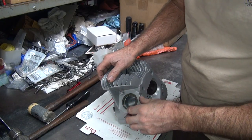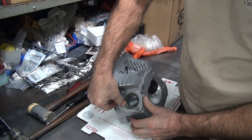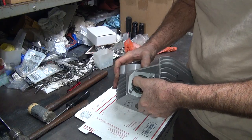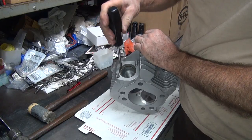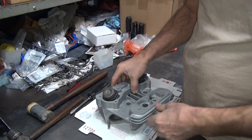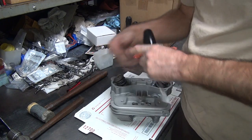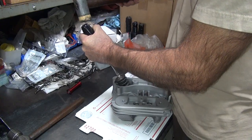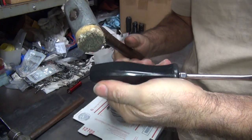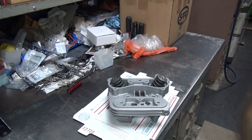This one's a little bit tighter — see how it wants to roll over. If you roll it over it screws up the gasket. Your thumbnail works good — best tool there is. I use my thumbnails for a lot of things, that's why they're always broken off. Okay, we didn't beat this with a hammer yet — make sure we hit it with a hammer. Using a plastic hammer on my plastic screwdriver instead of my steel hammer on the plastic — makes the screwdriver live longer.